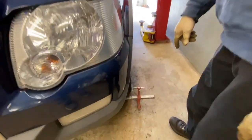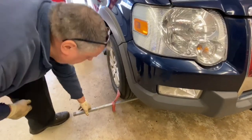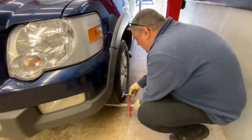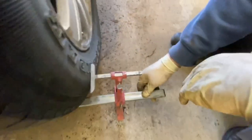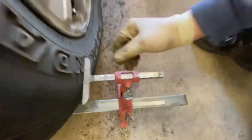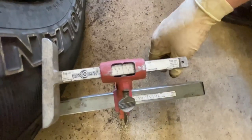See how easy that slides onto the wheel right there? Now we're going to check this side over here. Make sure the bar is sitting even — it's on there. Now this thing could go in a whisker, and there we are — we're at a 1/16th of an inch or 5/32nds. So if you're at zero or 1/16th of an inch, you're right on the money. We've got the white letter here that we're hitting, sticking out a whisker. So the toe is properly set on this vehicle and you will not wear the inside of your tires.